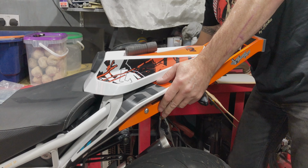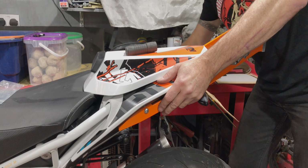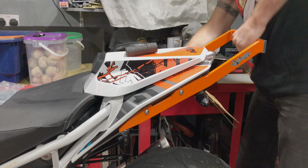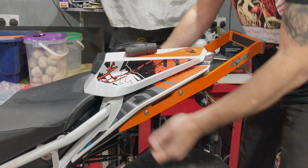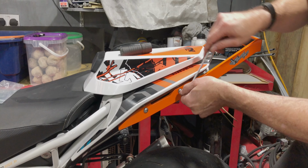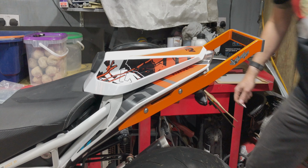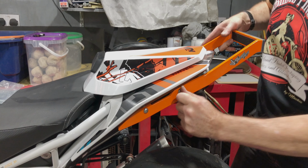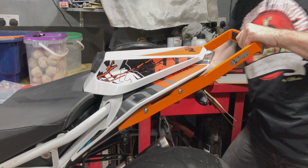As always, practice with fitting anything, don't try and tighten one part up and then wonder why the rest of it doesn't fit. Just snug them all down. Don't be afraid to give everything a good wiggle around. Make sure that any tension is taken out of it. And once that's done, torque it up so it's tight. You can use Loctite for these. It'll act as a lubricant when they go in and then stop them coming back out.